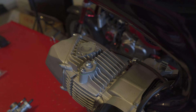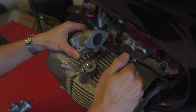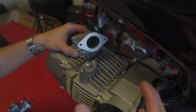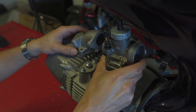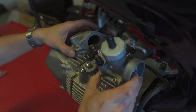Unlike the Zongshen motor, the Daytona 190 has two mounting options for the intake manifold: you can either have it running straight along the axis of the engine so the carburetor sits more like the stock CT70 setup, or offset for larger carburetors that need to hang off the side with air filters that take up more space. I'd love to run it straight, but there just isn't enough space — even with the throttle cable angled differently there wouldn't be room for the air filter. So I'm going to use the same offsetting I did on the Zongshen 190.